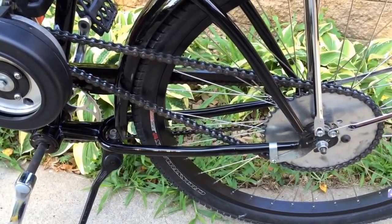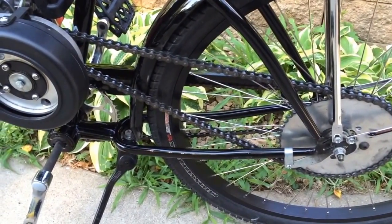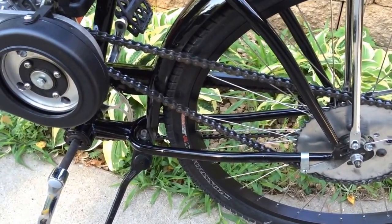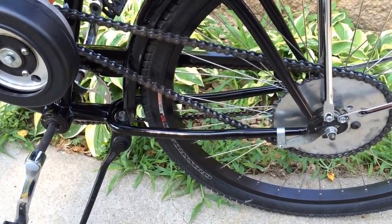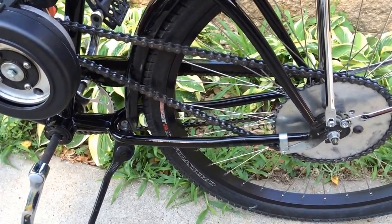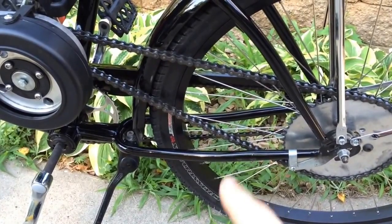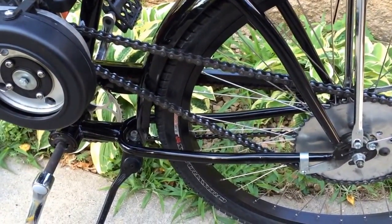You do have two chains on here — one for the drive side for the engine and another for the pedals. To get both chains to have tension at the same time with no tensioner is very rare, but I managed to do it. I got really lucky. I've been running for over 100 miles without any chain tensioner and it works fine. However, there's no speed increase and no torque increase — it doesn't matter at all whether you have an extra route for your chain or just a straight line.